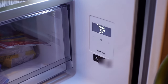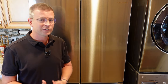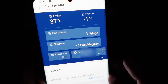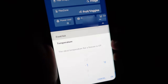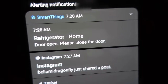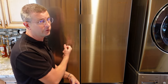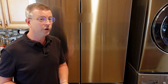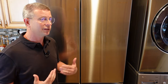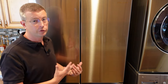The controls are right here on the refrigerator and you can control all the settings there. But what's really cool is this is a smart refrigerator — you can connect it to your Wi-Fi and install the SmartThings app on your phone. In the app you can control the entire refrigerator: change the temperature, change the flex zone, change the crisper, and turn the ice maker on and off. Really cool is that door alarm — you also get a phone notification if the door is left open. So if your kid grabs a drink and leaves the door open when you've already left, you'll get a notification and can go back to shut it, saving energy and preventing your freezer from thawing.